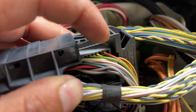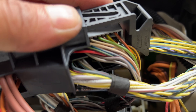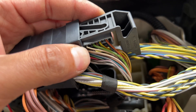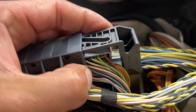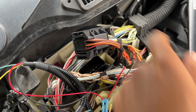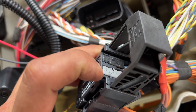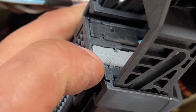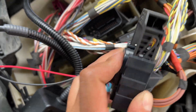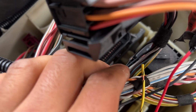We need pin 21 — a black one. It's kind of hard to see, but 26 is the orange one, then 25, 24, 23, 22, 21 — right next to the green one is the black one we need. I'm going to chase it down a little bit further so it's not so cramped up in here, and then we can just put this thing back. There we go, it's back in its place. See this little tab right there — you pull it a little bit and slide it out. Now I'm going to tap in this yellow wire into that black wire.